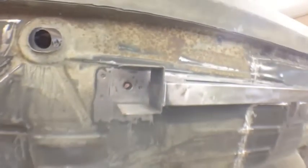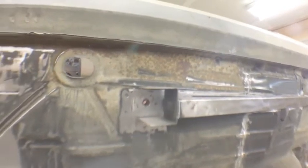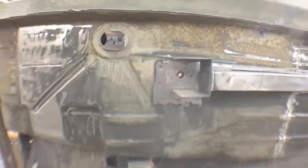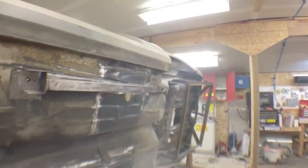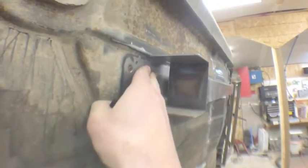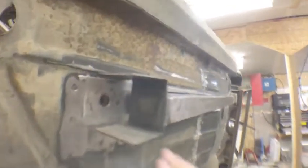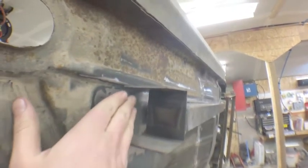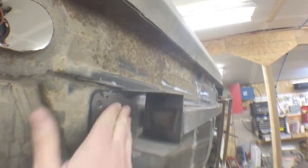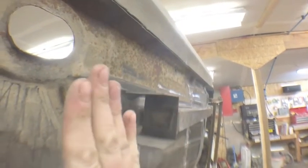It's going to be the standard depth off of the bottom of the pan. This isn't going to be a super low car, so I'm not too worried about that. I still needed to use solid subframe bushings — I think I have one of those around here somewhere. That sets my distance off of the base of the pan of the car. The subframe itself, after the bushing distances, sits off about three and a half inches. So I just measured out that distance, and this will be perfectly flush with the bottom of the subframe.